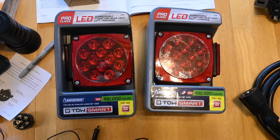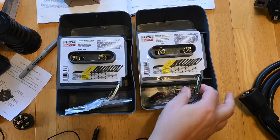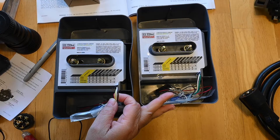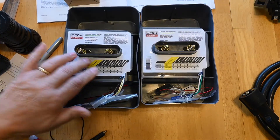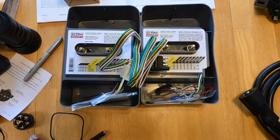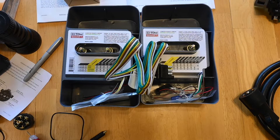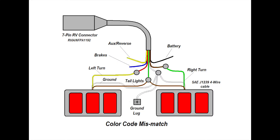We have a set of LED taillights — this is the left side or road side, and this is the right side or curb side. When you turn them over, you'll see on one side a brown, green and white wire, and on the other side a brown, yellow and white wire. There is also a red wire on each which you can disregard as it's just a battery that powers the light in the display box. This corresponds to the SAE color code for the taillights — right, left and ground. The problem occurs when the trailer manufacturer buys this by the thousand-foot roll and runs the wires from the taillight up to the front of the RV, then plugs it into a 7-pin cable which uses the RV color code — and the color codes aren't going to match.